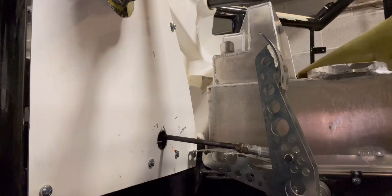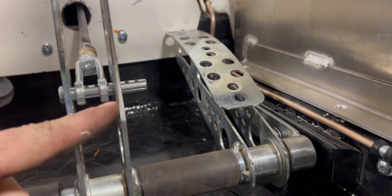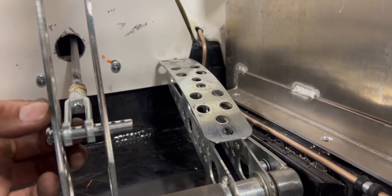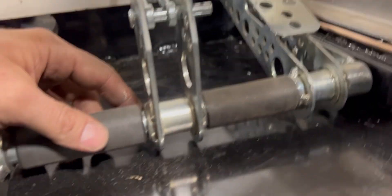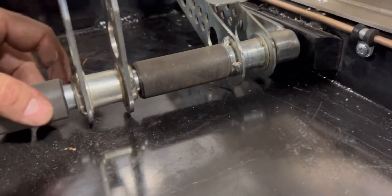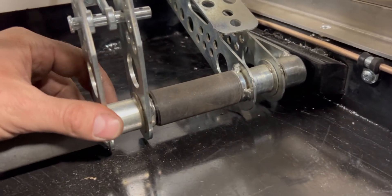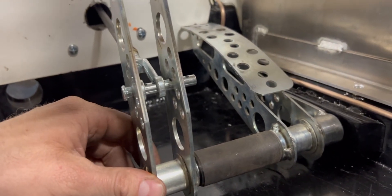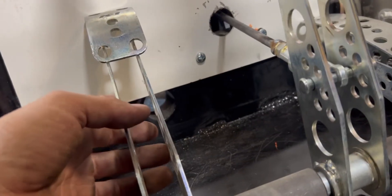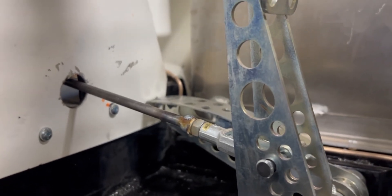There are a couple changes I want to make. This has a little bit of slop in it and I think I might find some nylon washers to put in there so it isn't so sloppy. Also down here these parts move back and forth, so I'm thinking I'll get some big nylon washers and put them in once I get everything where it needs to be so they aren't sliding around either. Since this works really well, I think I'm going to do the same thing on the slave cylinder — I don't have the parts today but that's going to be the move for sure.